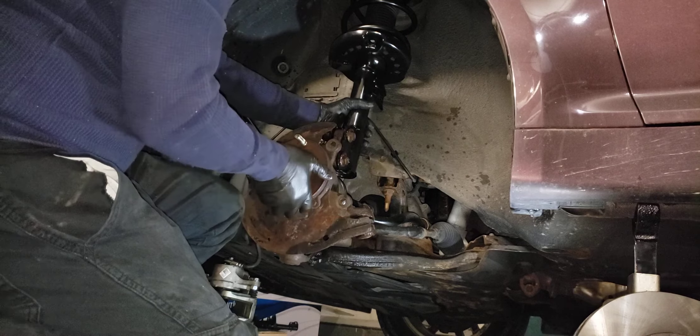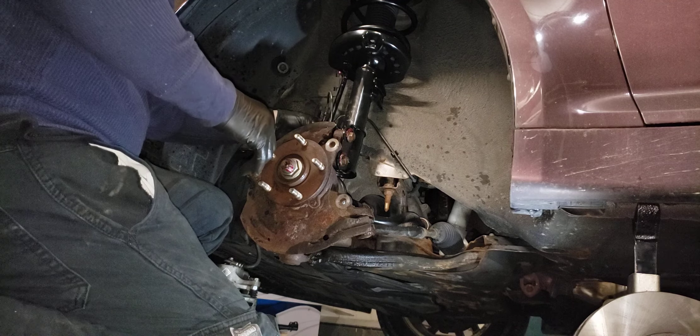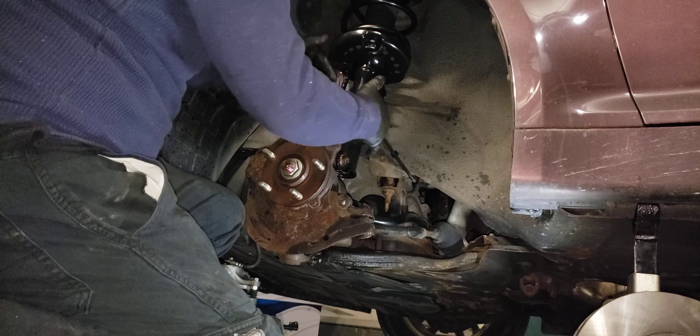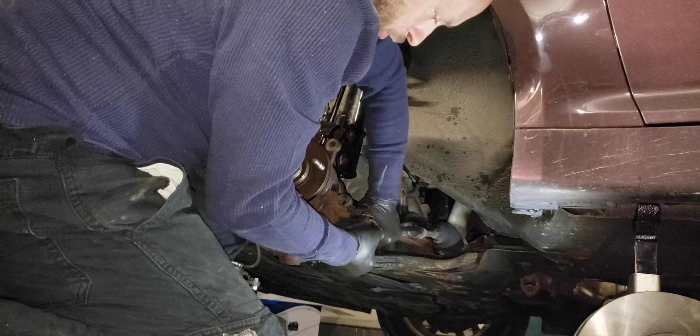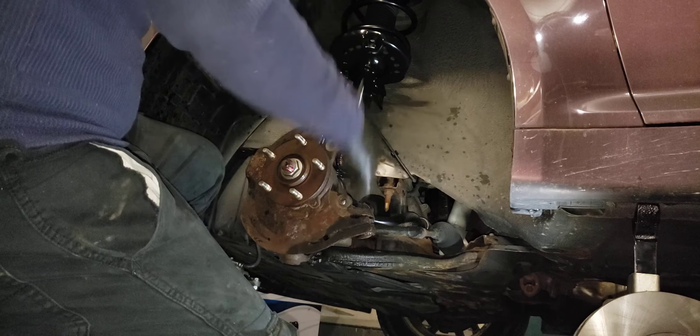I have all three snug right now. From here you're going to put your stabilizer bar link on, put your necessary connectors back on like your ABS wire and your brake hose, then tighten it down once I get my adjustment. I'll look at the marks on the other strut housing, get as close as I can, take it for a test drive, and recommend they get an alignment ASAP. That's basically it.